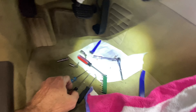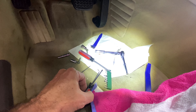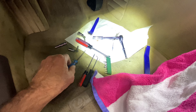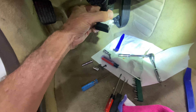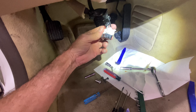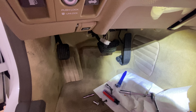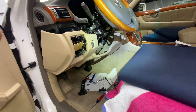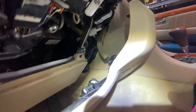There may be wires holding it in — yes, there are wires. So I have to release those. One technique I use for releasing wires is both a pick and a flat screwdriver: press the little tab to release it, then take the flat screwdriver to slowly work its way up. You don't want to yank on the wires — that's bad. Gently release the clip, take the screwdriver, and find a spot to gently work it up. If it doesn't go easy, just stop.